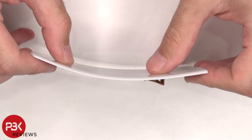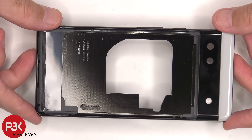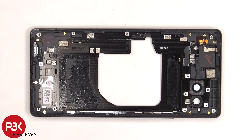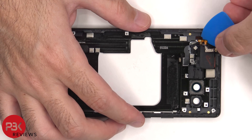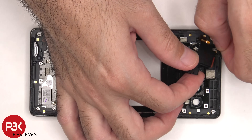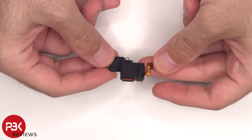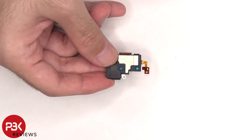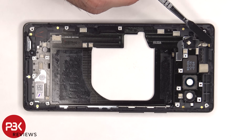Here's a better look at the plastic backplate, and here's the frame itself. The top panel and the camera lens cover can both be heated up and pried off as well. The top speaker is held down with some adhesive, including its flex cable, so we need to gently pry that off. It has a red rubber gasket around the opening and two locations with small white foam balls. And finally, there's a secondary microphone located on top which is attached to the flex cable for the LED flash.